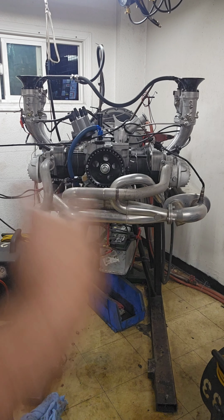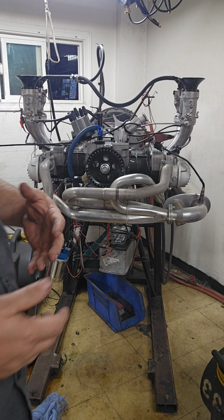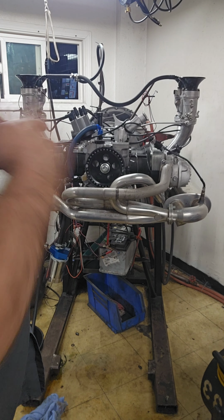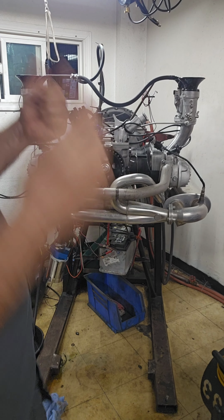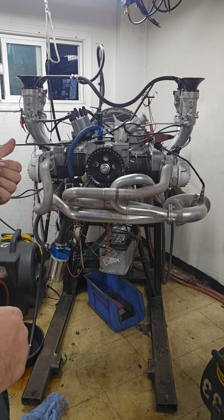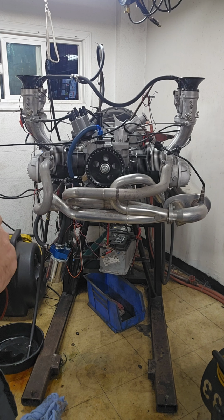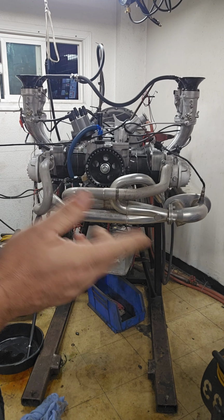On the pull, I was holding it at like 3,200 RPM with about a 30-pound load, and then hitting it under power. So if you're just cruising along, it was sitting pretty rich. It's got the Emerald emulsion tubes in here. It gives it a pretty rich setting when you're just cruising, and it's going to need a different emulsion for sure. But up top, it's fine.